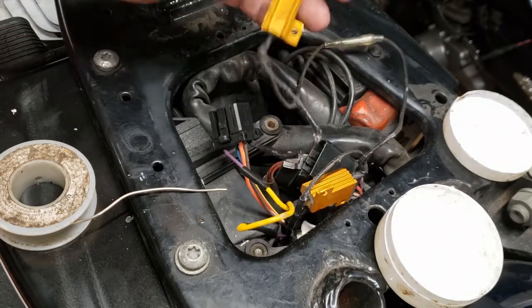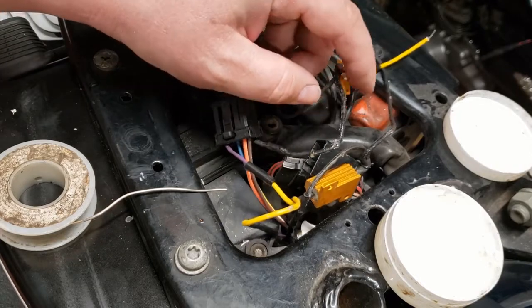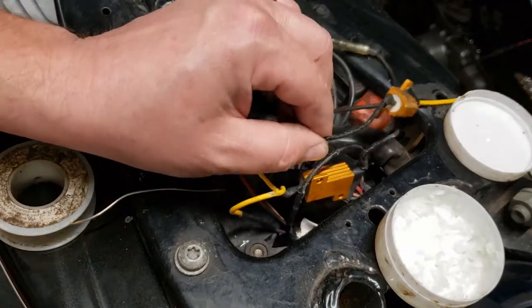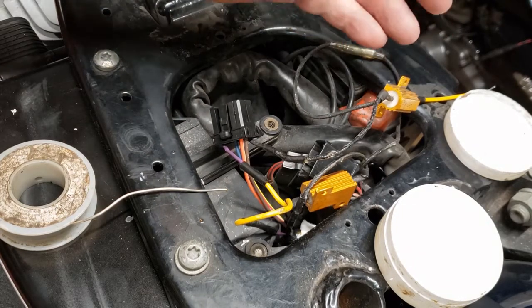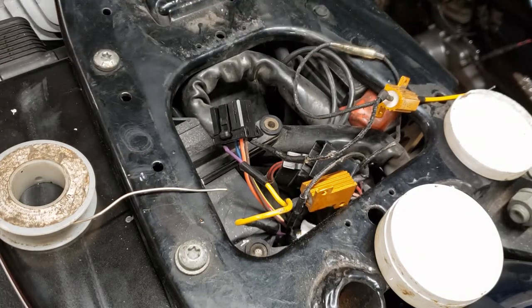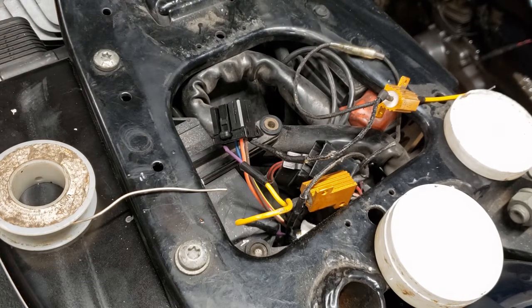You hook them up here — your yellow line to your positive lead, then the black line to your neutral. And I need to tape up that little damage there. These things basically draw that little bit of extra resistor current, so you get the cool bright LED turn signals without having to do the high-rent conversion kit.